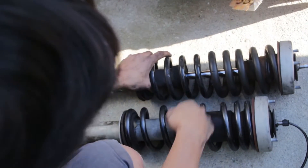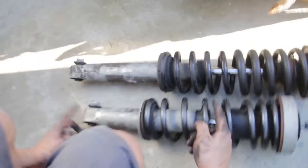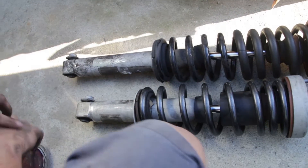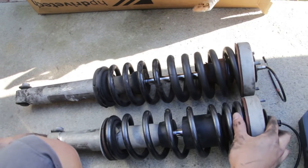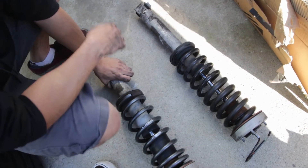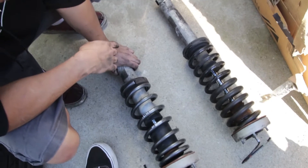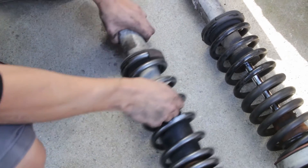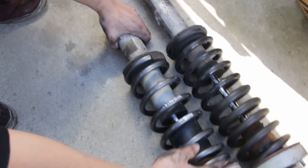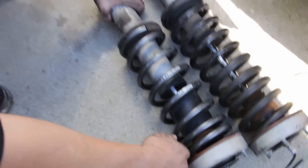I know why this didn't work — the length of the shock on M5s is different. From that point to here it's that long, but the M5 is like a good couple inches longer — that's why it sat on its ass. If you put them side by side, that's why it didn't work. From what I've read, these H&R springs from the M6 and the M5 — the E60 and E63 — are basically the same, so I don't see any problem there. If I were to line them up, it's about a good inch drop, so I don't think we're going to have any problems.